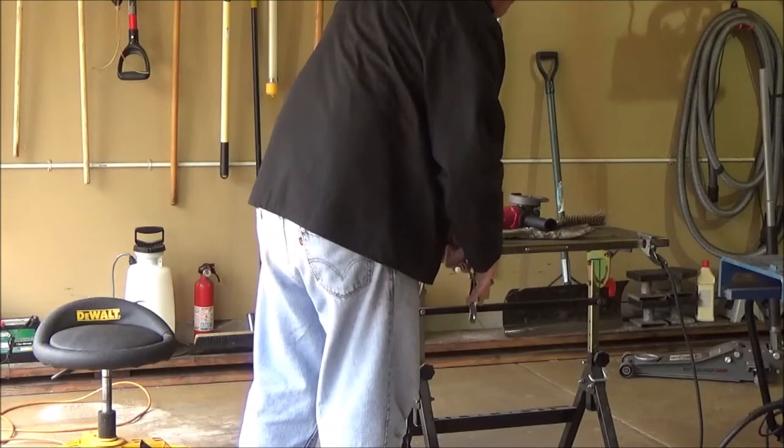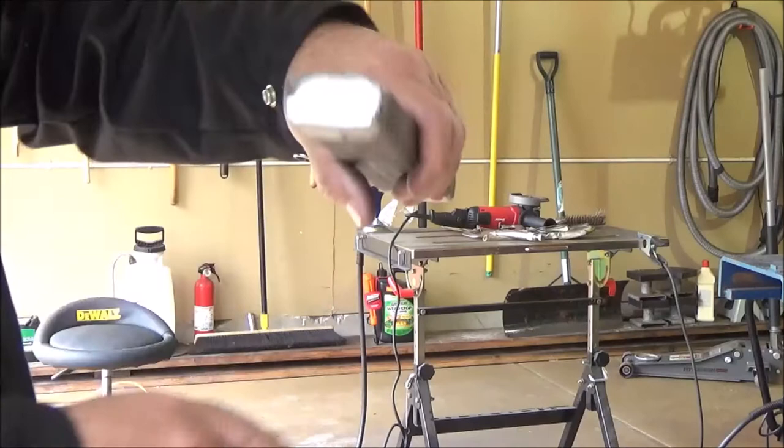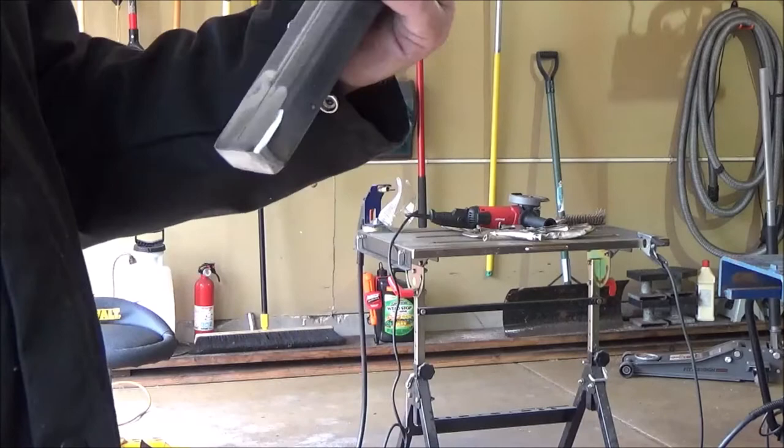Okay, so that should be it. We're almost 12:15. Probably started about 9:15. So I don't know how close to come. But we've got the caps all welded on there. So now, the big job. Got to move the lift, get the trailer in here, and do the scary part, which is cut off the axles. Grind those down so that these can be welded in as a spacer. We'll come back when we're set up.